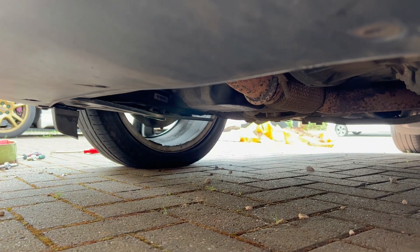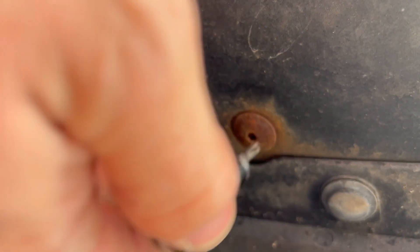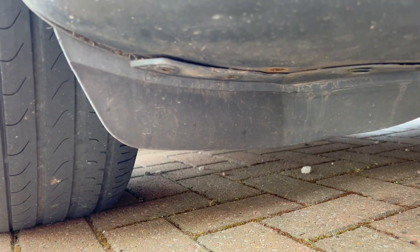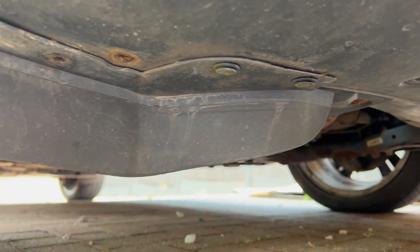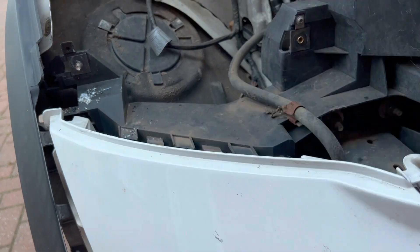You've got a fair few tabs to do. Once those tabs are out, you've also got some quite large T25 screws. One of them snapped straight away on me, so hopefully the other comes out. When it comes to the clips on this front wind deflector flap, you only need to do the two towards the wheel, not the front two — that's enough to loosen the whole bottom half of the bumper.